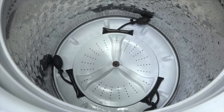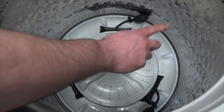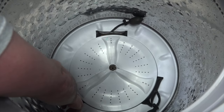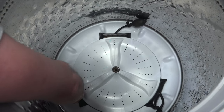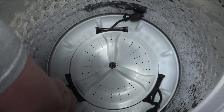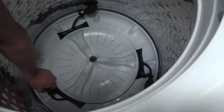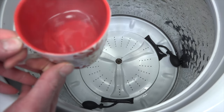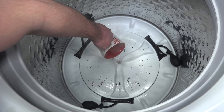If this one is very, very stuck and it's not going without a fight, you have two options. First, try relieving the pressure on one bag — sometimes it'll cause the plate to tip just enough to break free. Then pump it up again. If after a few minutes it's still not budging, pour some super hot water right in the middle.